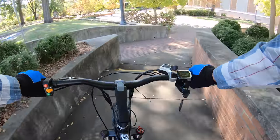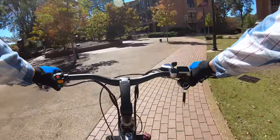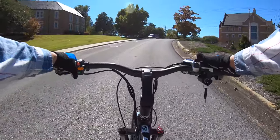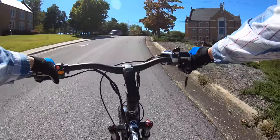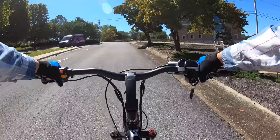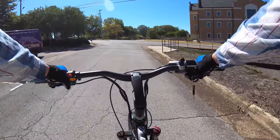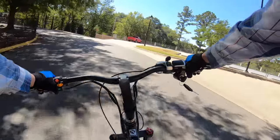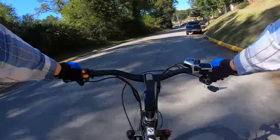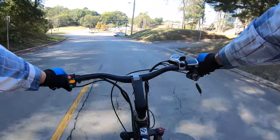I also quickly realized that the combo of fat tires and front suspension works pretty well together — easily capable of taking on any city obstacles I could envision. Even when I lock out the fork, those big wheels alone do an adequate job on bumpy sidewalks. But on hill climbing — at least on steep hills — the 500-watt motor does struggle a bit, and that's where that low magnet count on the cadence sensor comes in. Because there are so few points for the motor to switch on and off, it can be very inconsistent, especially if I have to stop and start on big hills. On open roads where I can get the bike up to speed, the cadence sensor is acceptable. I also didn't notice any drag from the motor on the XF660, so that's good.